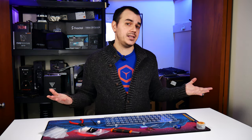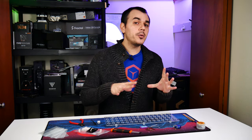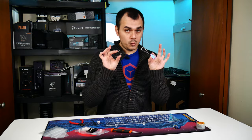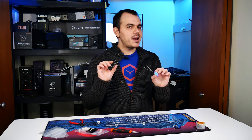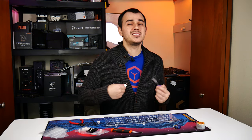If you're working with a keyboard that is hot-swap but already has switches and caps pre-installed — say something like the GMMK TKL Ice White Edition — and you want to work on those switches or add your own, you're going to need some switch and cap removal tools. The cap puller I have came with the Frozen Llama cap set from Ducky, and the switch puller came with my GMMK TKL. If your board didn't come with either of these tools, I'll have links in the video's description. You shouldn't need to spend a whole lot — they basically just need to safely and effectively remove caps and switches from the keyboard.